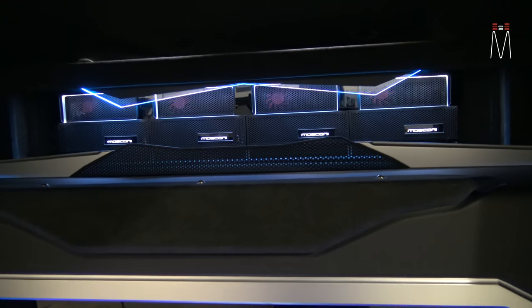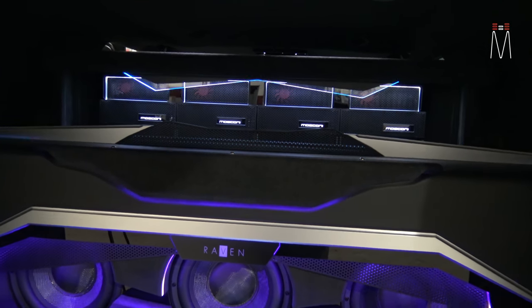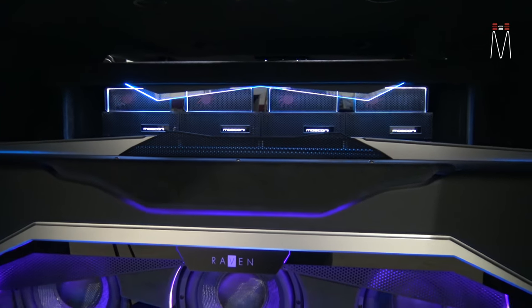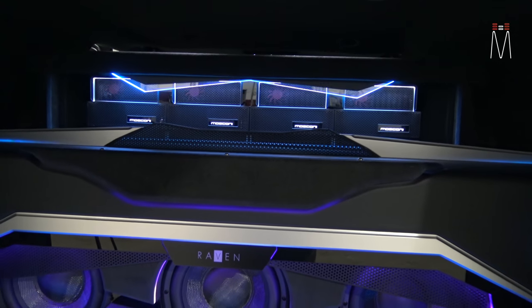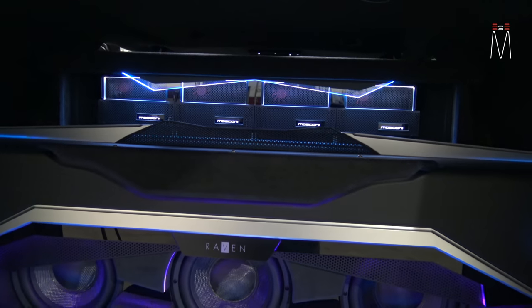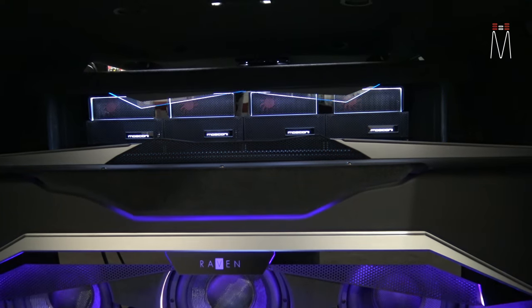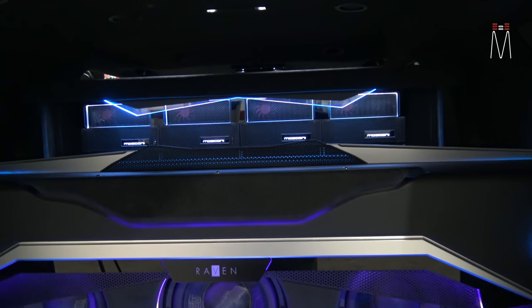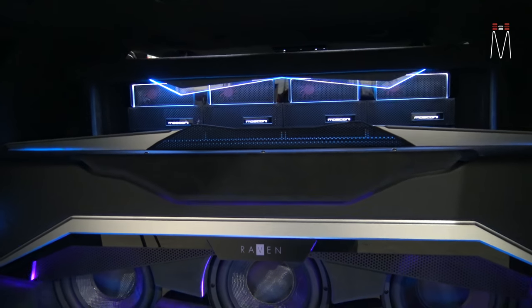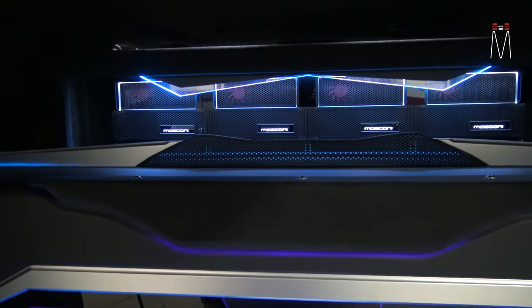panel. I really wanted to do that to be like a two-step action. It goes up and then the light illuminates to kind of give that cool flare as it hits the top. I did that by using an actuator limit switch. When it hits the very top, it basically just allows the 12 volt for that RGB light to go through. So I think that's really neat.